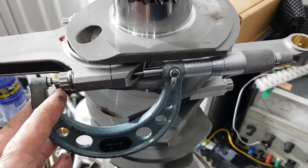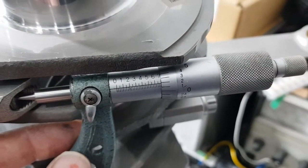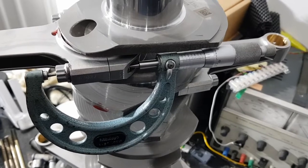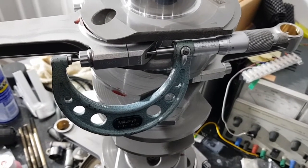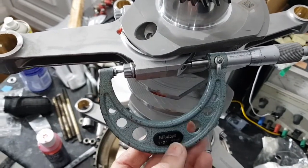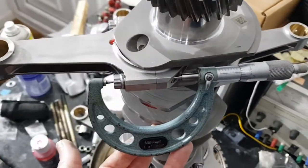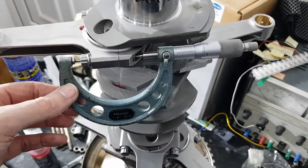These are torqued to a particular stretch. I've got the pin micrometer in there — you can see it's at 1.702 inches. I'm looking for 5 thou stretch on these, to a maximum of no more than 40 pounds-feet of torque. From doing all the others, it basically means you torque them to 40 pounds-feet and then check them. I do them both up to 20 first to make sure they're well bedded down, then tighten to 40. That's now at 1.707 — that's the 5 thou stretch, done up to correct torque. All six rods are in now, and that's as far as I can go before I get the crankshaft into the block.